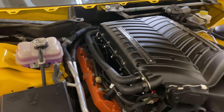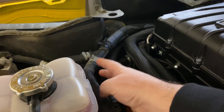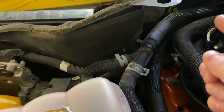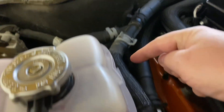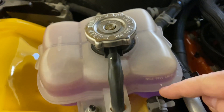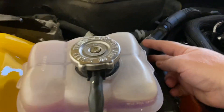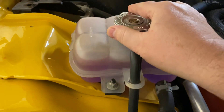So that's why this is super important. What we ended up doing is using radiator clamps or hose clamps, and we pinched off. You can see here there's a Y that comes out of the supercharger, out of the intercooler. It either goes over here and into the reservoir, or it comes here and feeds the intercooler pump. So what we're going to do is pinch it off here and divert all the flow into the reservoir where it has room to burp the system.